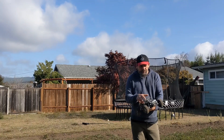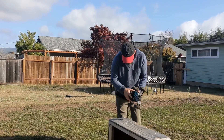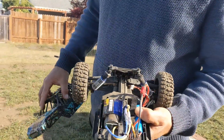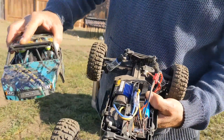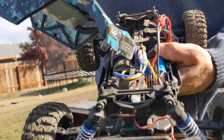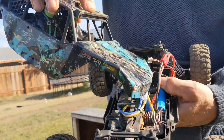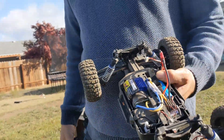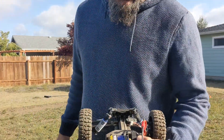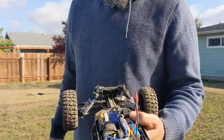This car is completely upgradable. It comes with a LiPo battery. It's got a 550 motor, full-size servo, and ESC. You can totally upgrade this — move the ESC up to the top rail, put a longer battery in it, a two-cell 7.4V 2200 milliamp battery, and it will rip, guaranteed. We're going to do that, so stay tuned.